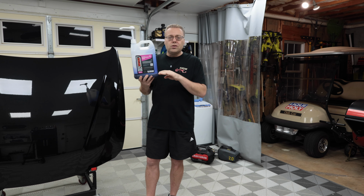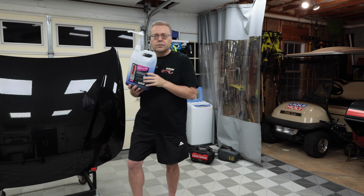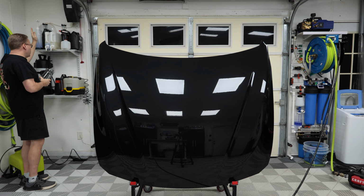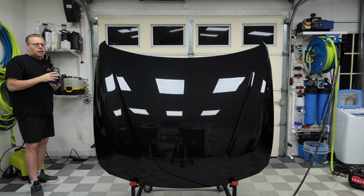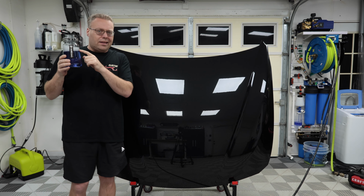It's the same soap and dilution we use in every single foam cannon video to make sure we keep everything on an even playing field. So I keep my Incredible Suds diluted over here. Like I said, 32:1, it's so thick, it's just easier. But if you do this, I'll link these kind of jugs below. You really shouldn't leave this in here for more than 2 months at most. The best thing about pre-diluting this kind of stuff is you only use exactly what you need.